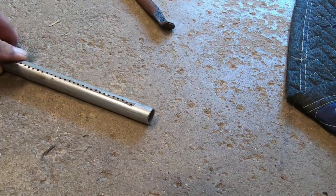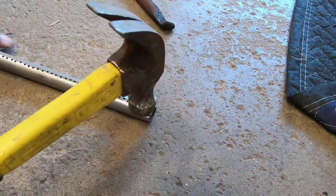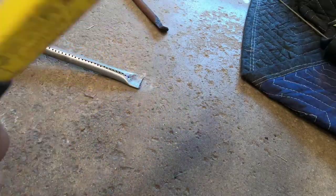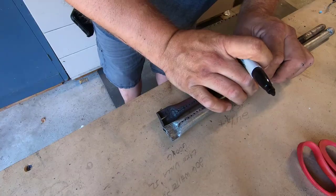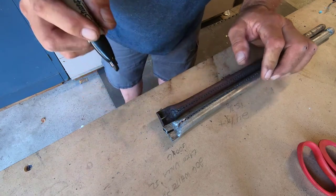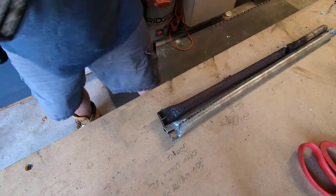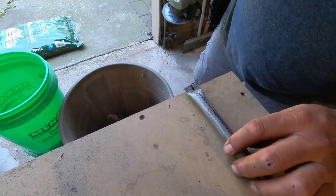Now I'll check to see how far I need to flatten the end, and I'll use a hammer to do this. Make sure when you're flattening the end the burner holes are facing straight up. Now I'm going to mark and cut the slot. I'm not going to be reusing the clips, so I just cut the slot all the way through. This is just so the burner lays flat on its mounting bracket. If I have to, I'll use screws to mount it to the bracket.